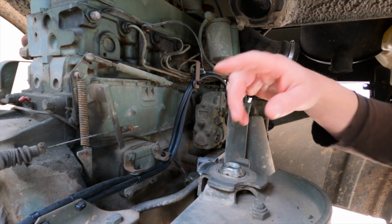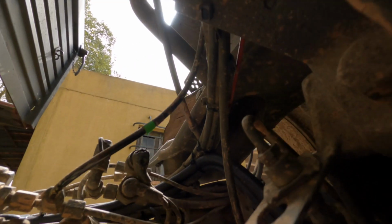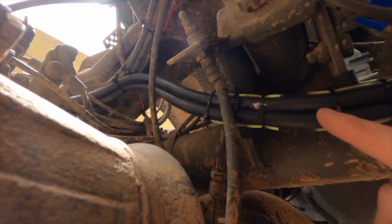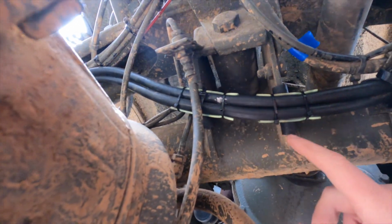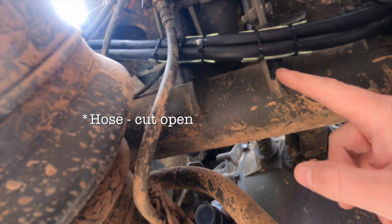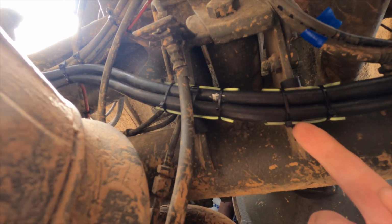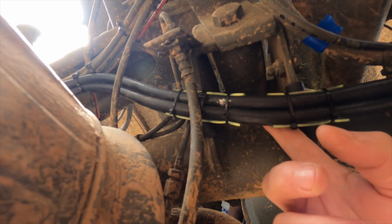The only thing is that it took a long time to get the cross member done. I'll show you that one. The fuel line goes from the tank side and then crosses here. One of the problems here was that these pieces of metal on the frame are quite sharp. So there's a tube here, a tube here, and an inner tube from a bicycle wrapped around this. Then there is another piece of rubber plastic hose here, which is zip tied to the double hoses here.